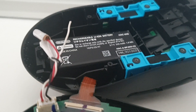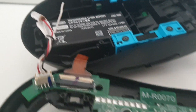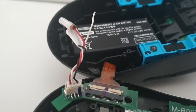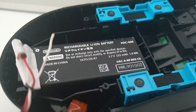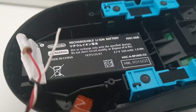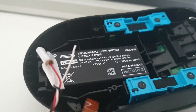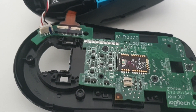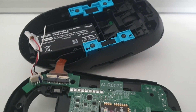I've basically more than doubled my battery capacity with this. It's a pretty simple process. I did have to cut out some of the plastic inside — there was a bunch of extra standoffs for the original battery that you have to cut off to be able to fit this one in. I also had to cut the USB holder off the base, but other than that it was a pretty simple mod.